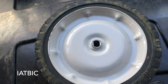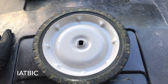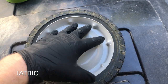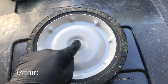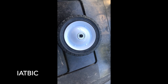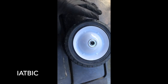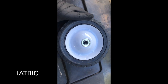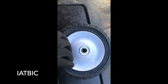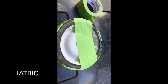While I'm upgrading the mower, I grabbed a five-dollar can of spray paint — the color used for fire hydrants — to paint the wheels. I'm taping around the center hub and cutting with a razor knife so I don't get spray paint in the hub. Make sure the metal part is nice and clean before painting. I wiped these down with a rag and a little water — it doesn't need to be perfect since this is just a lawnmower.